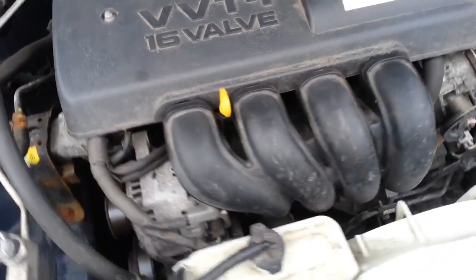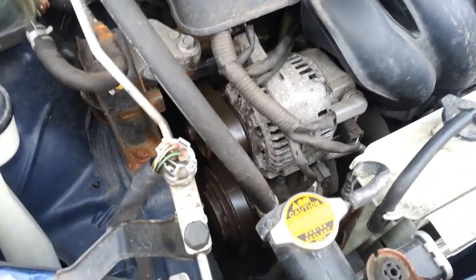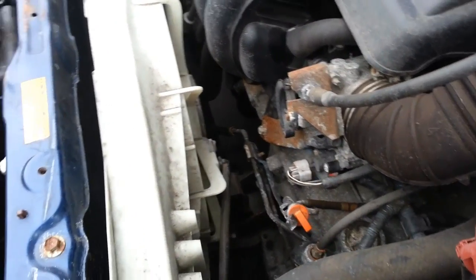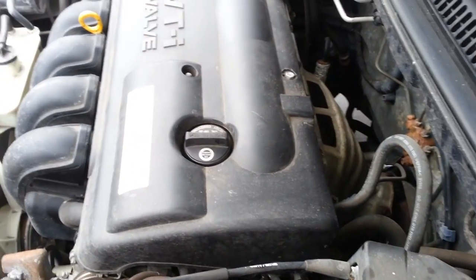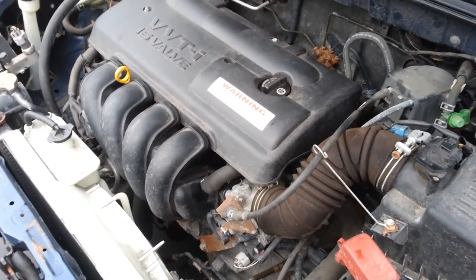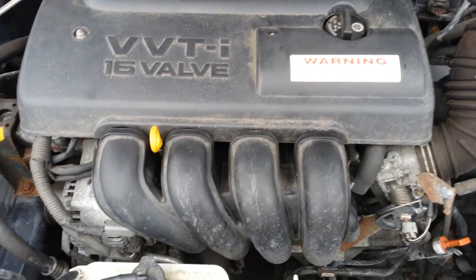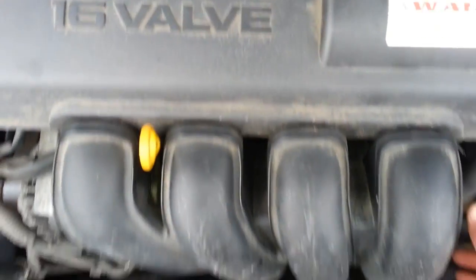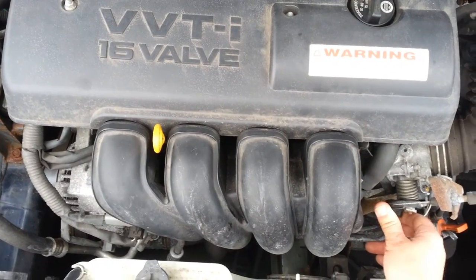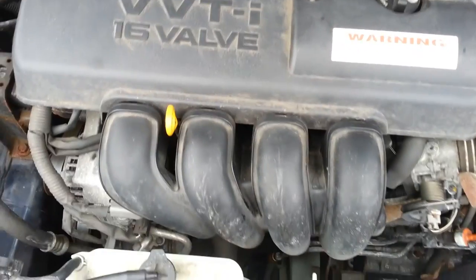All right, it's been 24 hours. Oil pan set up. Just filled it full of oil. Started up. Sounds good. Looks like for now everything's in good shape. So, summing everything up, if you got a knock on your connecting rod and you notice it pretty quickly, it doesn't do any damage, you can get it cleaned up, replace the bearings, hopefully get a lot of miles out of her. Let's get this thing started up. You can hear how she sounds now. Alright, it's a beautiful thing. No more knock. Beautiful thing.